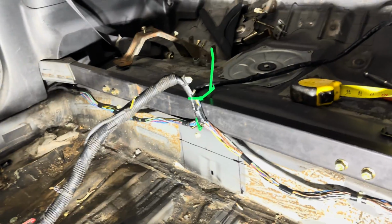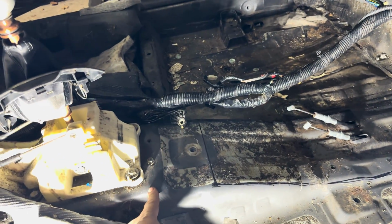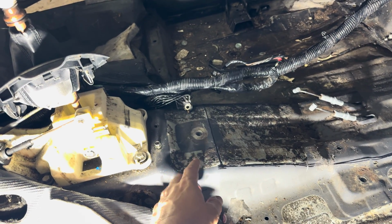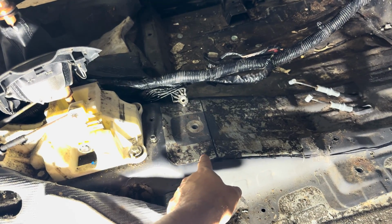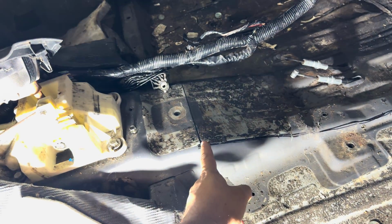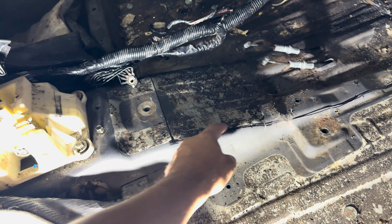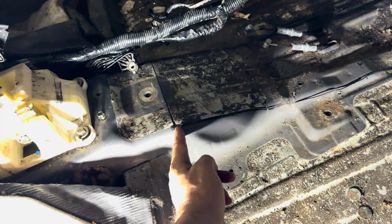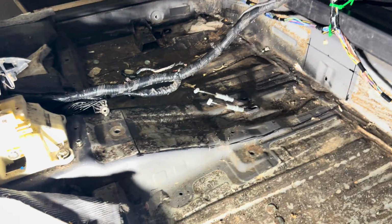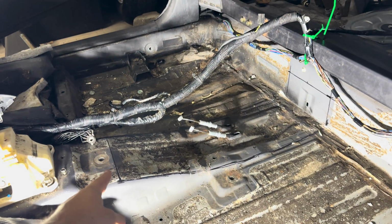So yeah, it's 7 inches across, and then it's 23.5. I see people cutting up here, and that makes me want to scream too. You do not need to cut up here. You only want to cut up here because you can see the transition starts lowering here, and then it really starts descending around here. So you want to cut it here, and you don't want to cut across here. You want to do 7 inches and cut across here. I see people going down and they're just hacking their car up. It's shameful. Don't do that. So mark it, do 7 inches across.